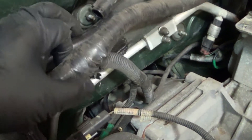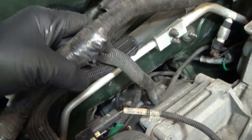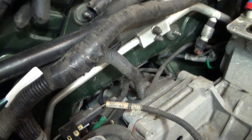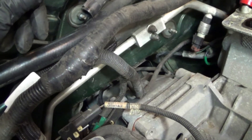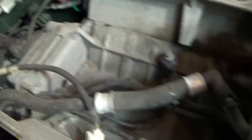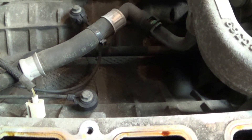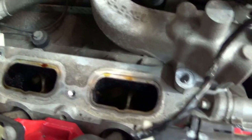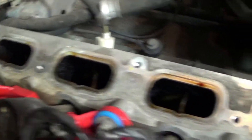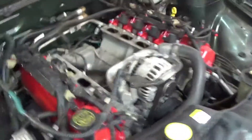One thing I forgot to do was disconnect this electric line from the back of the intake. When I tried to get that off it just pulled out of the tape, so we'll worry about that when we put it back together. All the plastic that holds this stuff in this car is kind of dried and cracking. You can see the valley in mine was not full of mouse turds and all kinds of crap - that's a good thing. I notice a lot of carbon down in the intakes - I think it has to be coming from the charge motion plates.